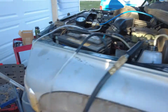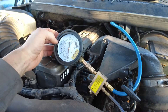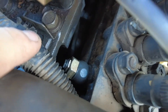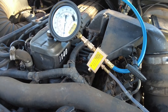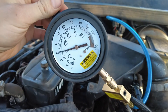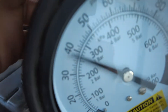We're going to start it up. I got a fuel gauge hooked up to it — I just want to make sure it's in specifications. I actually have one of those adjustable fuel pressure regulators in there, it's like a Torque Tech one. You want it at about 40 PSI at two grand. Right at 40 at two grand — very good.